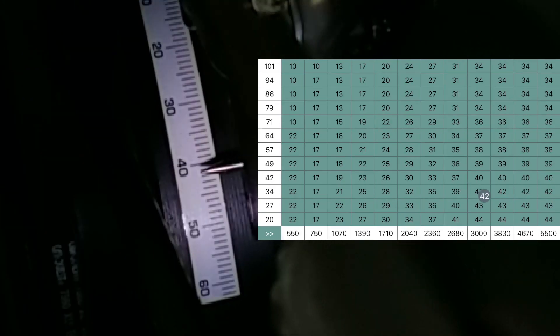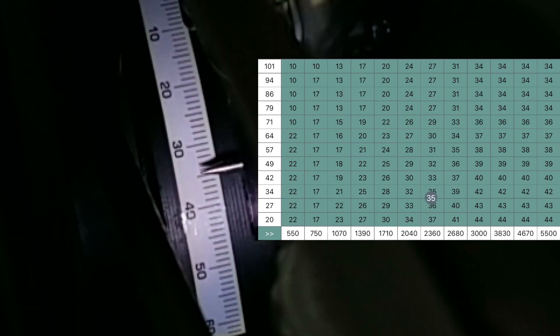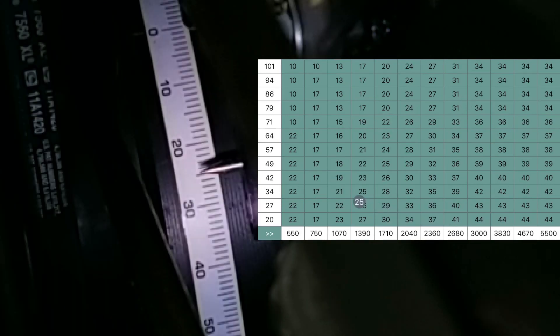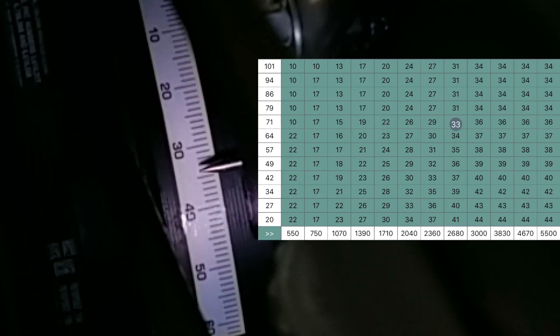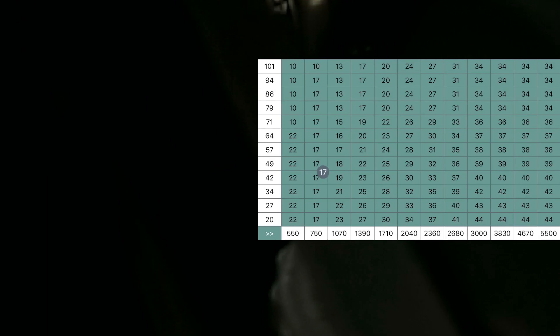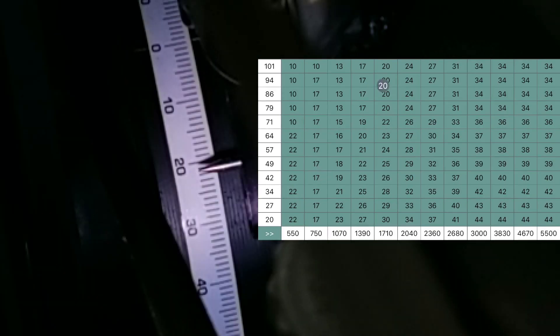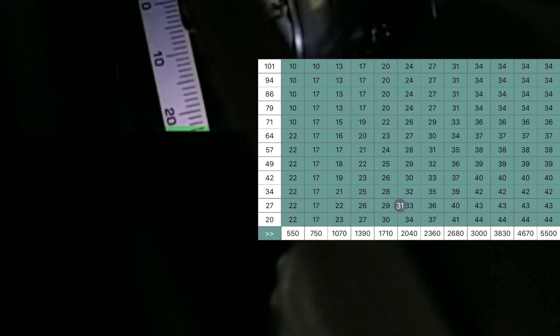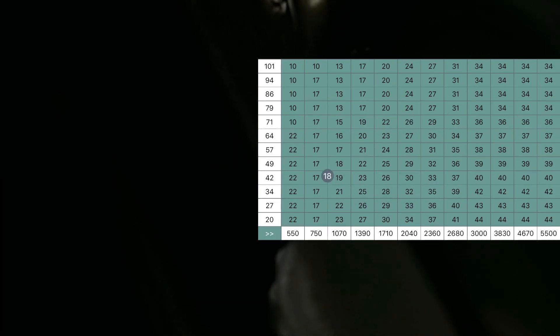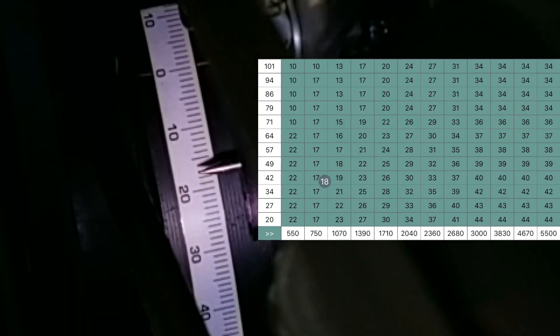As you can see, the bubble moving around the screen tells you what your timing is in real time. And you can see as you move the throttle, the effect that it has on the pressure and the RPM. You can also see the timing number — it gives you all the information you need to tune your table. All of the advanced cells are tunable; you can also change the RPM breakpoints and the MAP breakpoints, and the rev limit. You can save as many tables as you want in the phone and switch to them at any time. You're going to get so much better performance than a mechanical HEI, and it's so much easier. Subscribe to my YouTube channel to see more tuning videos.